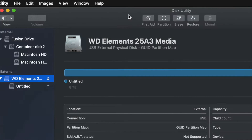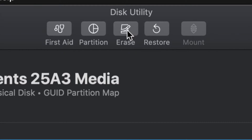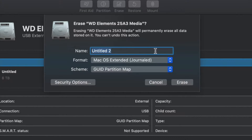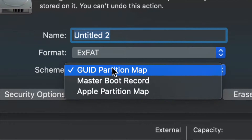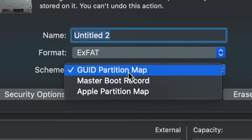Select your very first option. From here we're going to erase this — Erase is on the top, it's your third option. Erase will format, and formatting means deleting everything from within the external hard drive. Once you click on Erase, this is the most important part: for most of you, all you have to pick is exFAT. Just make sure we keep it under Master Boot Record, because later on if you want to partition it, we won't be able to otherwise.